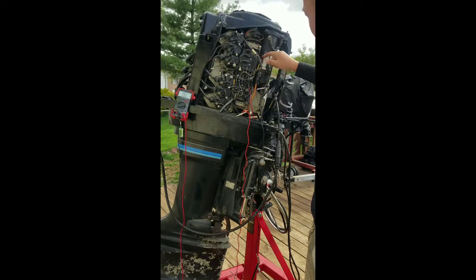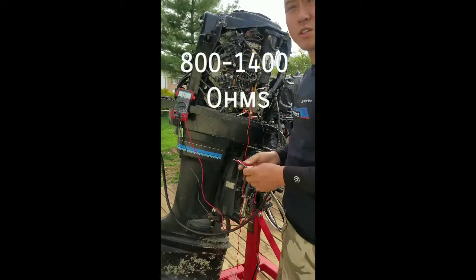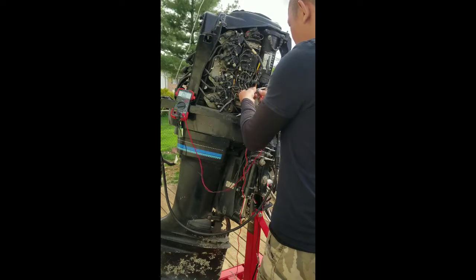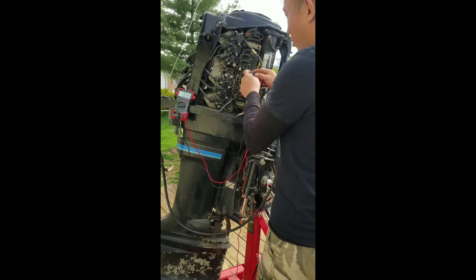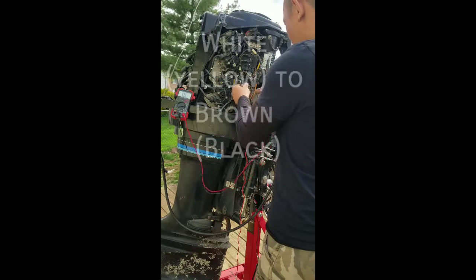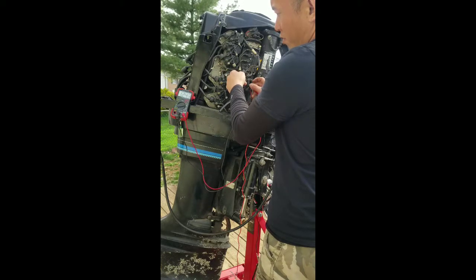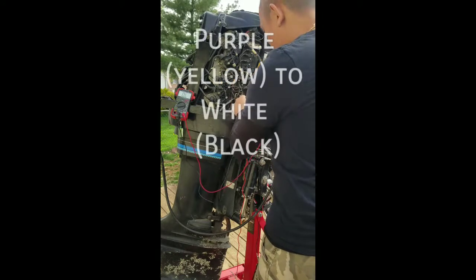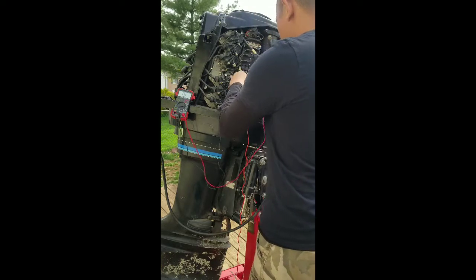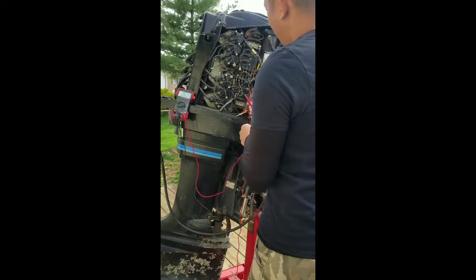The way that you test the trigger, you have to go from the yellow sleeve to the black sleeve. We're looking for about 800 to 1,400 ohms. First step: brown-yellow to purple-black — reading 1,220 ohms, that's good. Next, white to brown — good. And finally purple to white — reading 1,277 ohms. So this trigger is good.